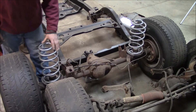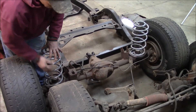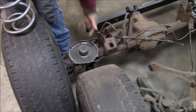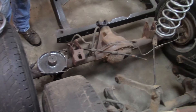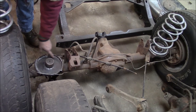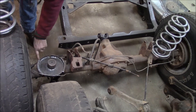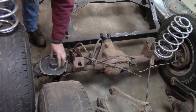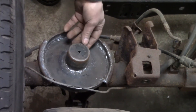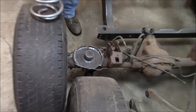When I pulled the axles off the old frame, the old springs were mounted on these spring perches and there's a rubber pad there. When I pried the spring off, they were so rotted they were completely gone, and I thought I was going to have to search out some new axles. But I took some eighth-inch plate, made a base for it, and welded it to the side where the existing bracket was. I got a two-inch pipe nipple to make a bump stop — it's about an inch taller than the stock one, but I figured I'd be alright because I'm putting two-and-a-half-inch taller springs in.